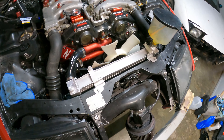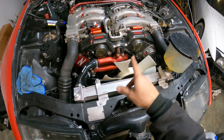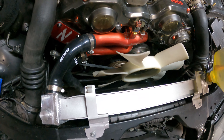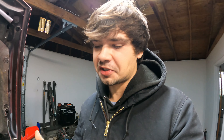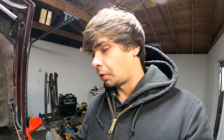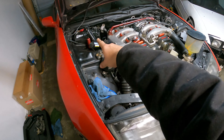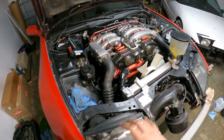We got it all back together. We topped up fluid, started it up, made sure there's no squeaking or issues. We got a power steering belt on it now, alternator tension all squared away. Pretty much ready to go. The only bummer is I think Gabby has my multimeter. I do already have a video on this on my Z32 diagnostic video, but I've already set this and tested it on Brian's car twice. We need to hook up our timing light because that is our first priority — get it up to temp and then time it immediately.